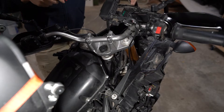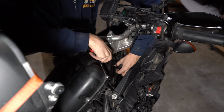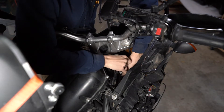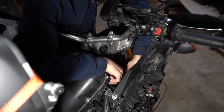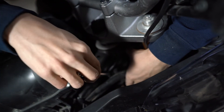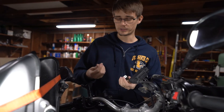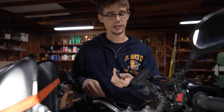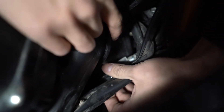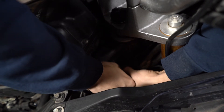Go ahead and take this cable tie clip apart. Using an 8mm wrench, remove the mount that holds this bracket in place. Underneath there's a little bolt holding this bracket — grab your 8mm wrench again, take out that bolt, and set the bracket aside. Take the bolt you just removed and then the insulated clamp from the kit, use this to go onto the brake line, and then mount the brake line to the bike using that same hole the original bracket came out of. You'll need to squeeze it together once you get it over the brake line.